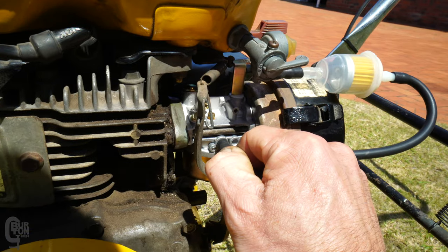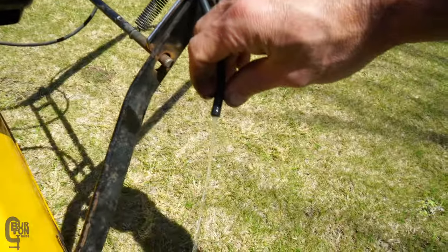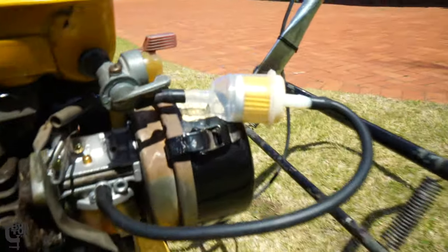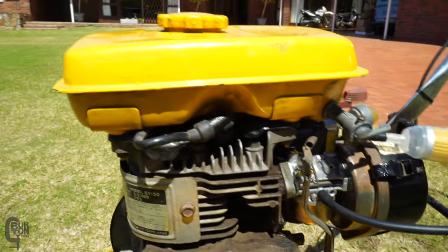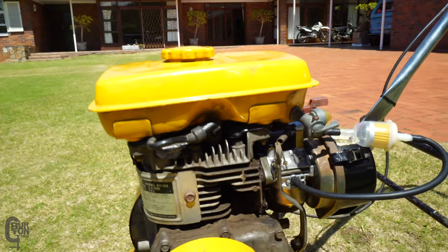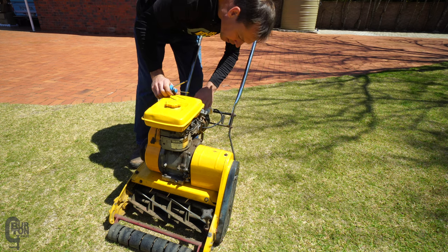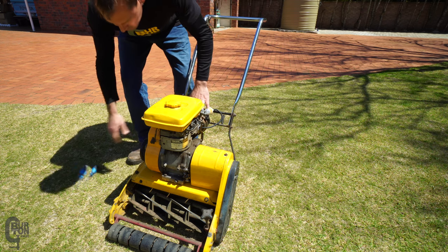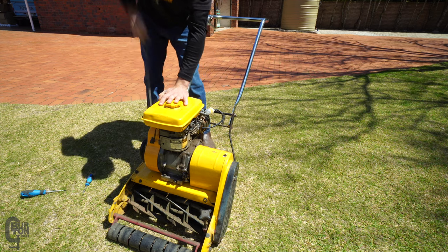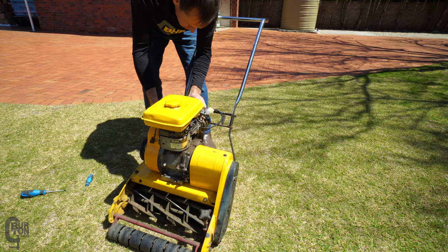Let's pull off the feed line into the carb - yeah, there we go, the fuel is running onto the grass, so fuel flow is confirmed. We should have checked the spark plug - yep, checked, and I think we are good to go. Two things I didn't check were the idle screw setting and the idle mixture setting. I've got these two screwdrivers - I suppose we should try and do it now. That would be the right thing to do.